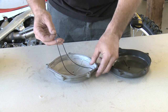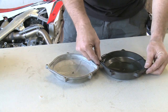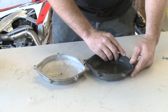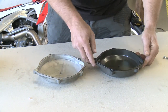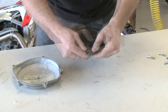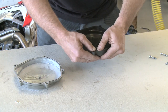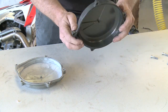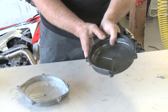With the stock cover you can usually reuse the O-ring if you're careful with it. Line it up in a similar location as the stock one — be careful not to stretch it out. Just lightly push it in; don't work it around. The Henson has a groove cut in here that's really nice and will hold the O-ring in place. Once you get it all the way in, push it down a little more firmly. If you end up cutting or tearing it, don't try to gasket-seal it up — you need a new one. Push it all the way down all the way around the entire cover, then on a clean surface push down firmly and feel that it's seated really nicely all the way around.